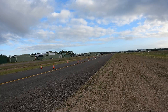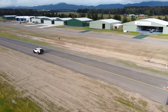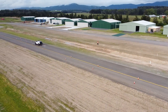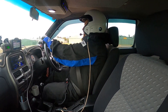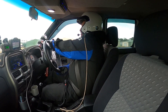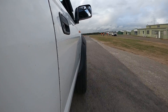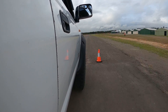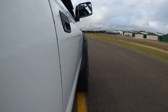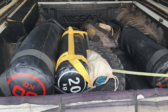The second stage of testing is the same as Test Mass 1, plus 68 kg times the number of seats in the passenger compartment calculated for the weight of the driver, and 13.6 kg times the number of seats evenly distributed over the luggage compartment. These are the New South Wales requirements from LT2, as some states use 7 kg times the seating for the luggage area. Loading of the weights needs to be secure so as not to move around during the test, and can be placed on the vehicle's floor to keep the weight as low as possible.